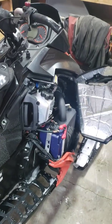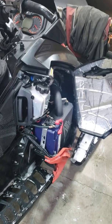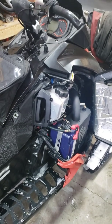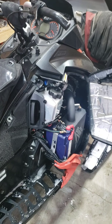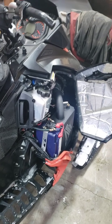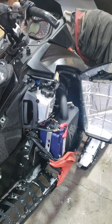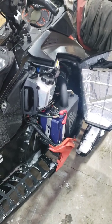In summary: really good battery for lightness. Really good battery if you have a recoil and will pull-start in the mornings. If it's below minus 20, it's not good, and if you're relying on your battery for cold starting, do not get this battery. If you have a four-stroke, stick with your lead acid battery.